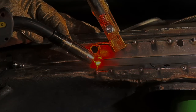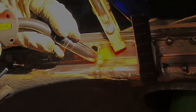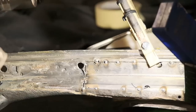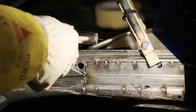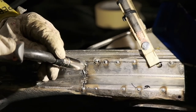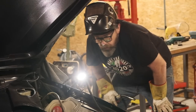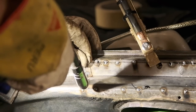So what can be done? Manufacturing the repair panel with even tighter gaps isn't the way to go, because at some point it needs space to do some heat expansion. The moment when the arc ignites is very delicate — the gun pushes welding wire into the gap, but the edges may just burn off and the wire doesn't find anything to connect to. Adding some additional material before the melting even starts is a good way to avoid that pitfall.